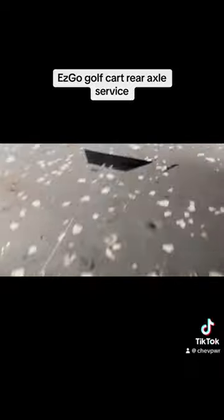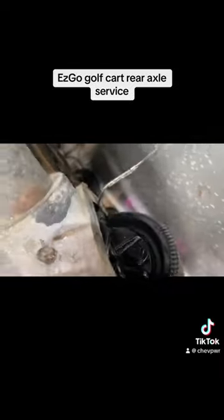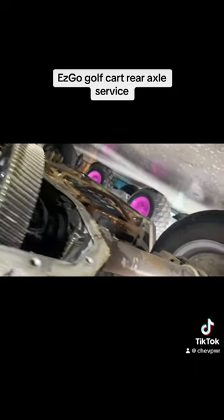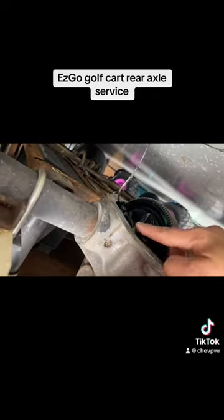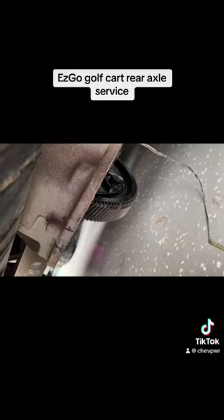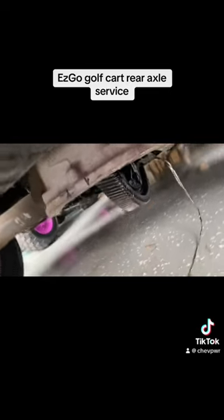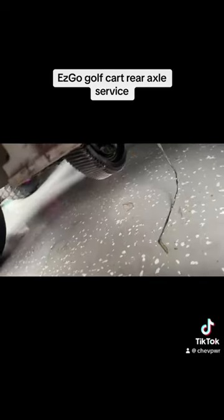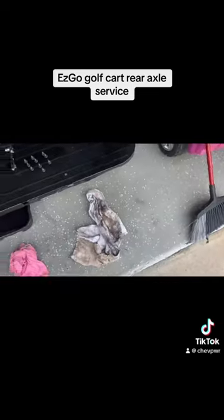So I wanted to show you guys something. I got an open blade here, and as you can see this is the silicone on the inner edge. I'm just going around with the blade around the perimeter of this housing and basically removing all the excess silicone. And then I'm going to do the same thing to this surface here as well. Surprisingly, I didn't get much oil out of this whole thing, so I know it wasn't leaking — that's a good thing. I guess I'm doing an oil change here. So now we wait for the paint to dry, but I'm going to show you.